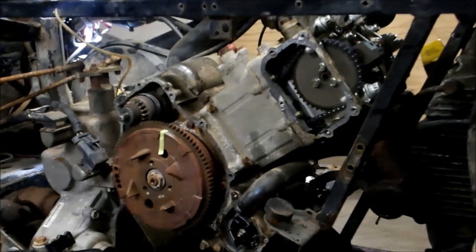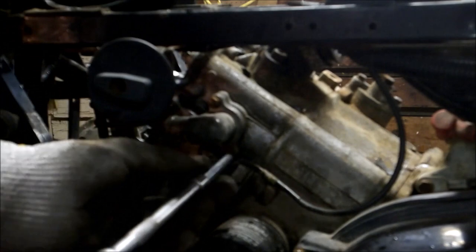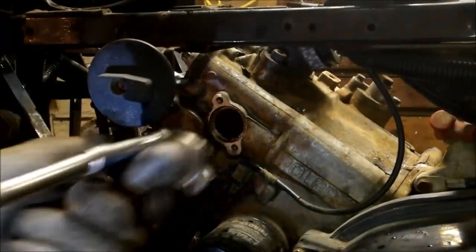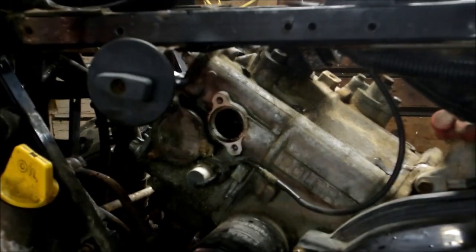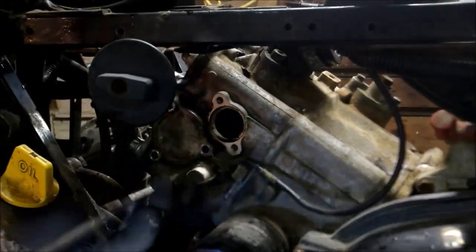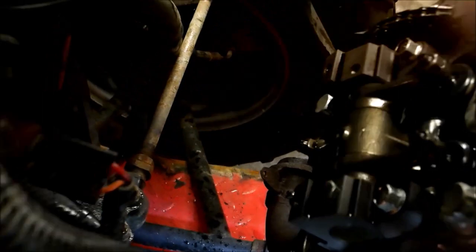We're going to go to the other side of the machine. So you've got your elbow for your top coolant hose and then there's an access cover for the cam down here — I'm going to pull that out. The thermostat came with it. There are one, two, three, four bolts — we'll take those off and this will come right out, allowing us to slide the cam off.